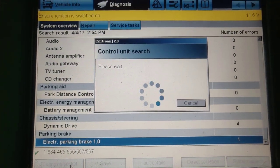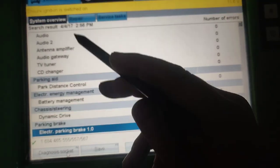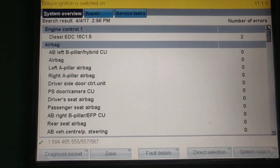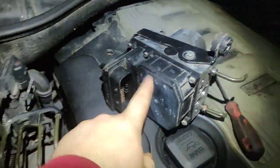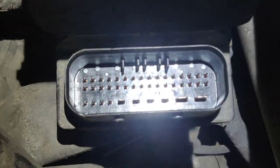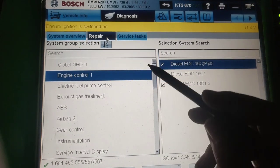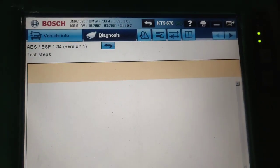As you can see, how many faults we have after switching the ignition on and off — all about CAN communication. If the CAN line is bad, you need to find what the problem is. The first thing that can be bad is some kind of power supply. The ESP and ABS system is located in one control unit with only one plug connected. What we'll do first — if we have another used unit, we'll just connect it and diagnose.